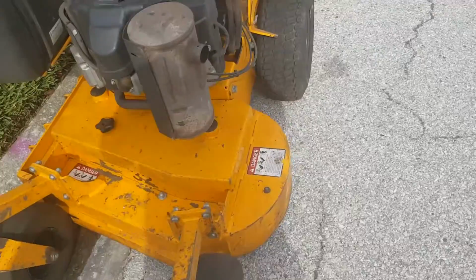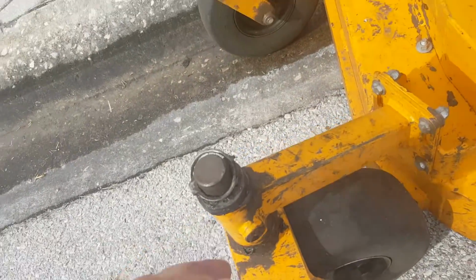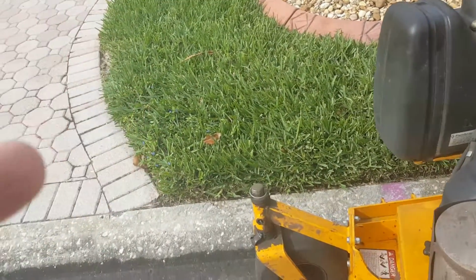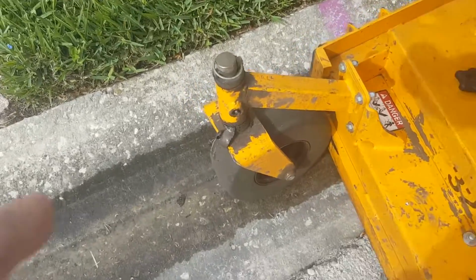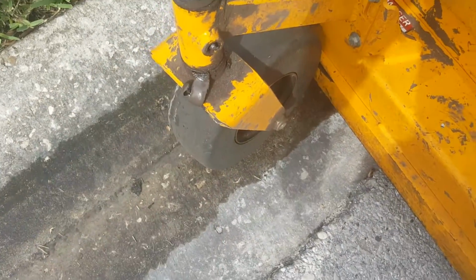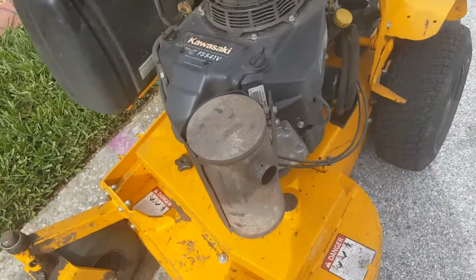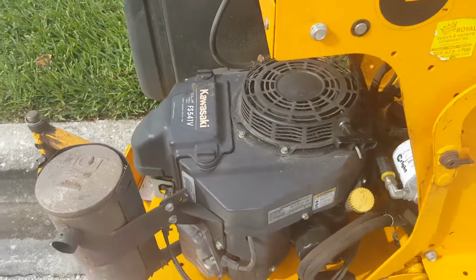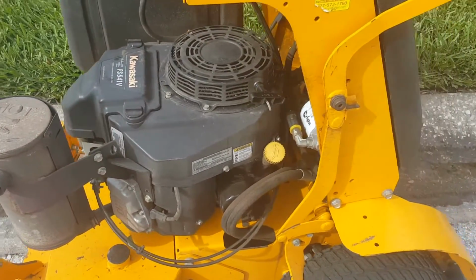So the other con is the bushings in here have worn out twice. That could have been my fault for not greasing them enough. So I've replaced those twice. You can see we just greased this. Look at that grease going out. I need to wipe some of that off, but make sure it gets plenty of grease. Carburetor got clogged up a little bit. Started running rough. It was surging, but we put some treatment in it, cleared that up.